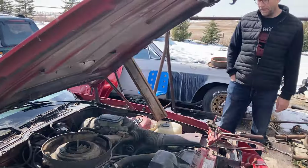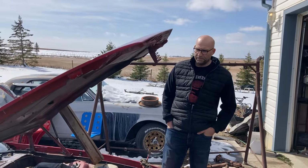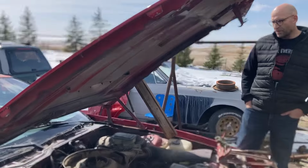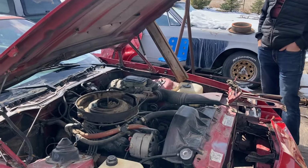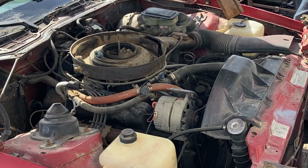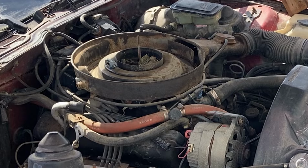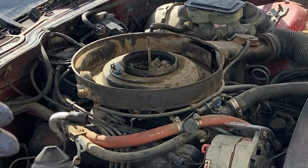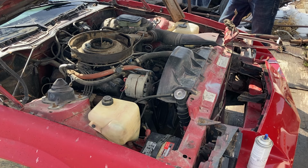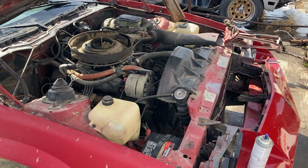Mike, what do you say? Now that we've got your repair drawing there, why don't we see if that fuel pump repair works? You go pump the gas two times, hit that key, see if it fires up. It should start. It's just a matter of whether or not it sprays out the bottom. Yeah, well, we want to start it before we take the carb off. Make sure everything's working, and then we can take the carb off, because you knew it ran before. So we'll take the carb off after we've confirmed the new fuel pump works. Otherwise, we could be chasing two problems, right, and we won't know it. So I don't know if it doesn't work after that was our fault for the carb. Correct. I think two pumps. Two, you think? I think so.